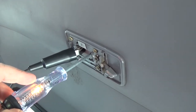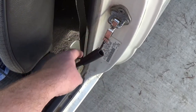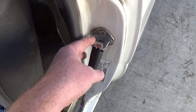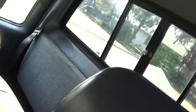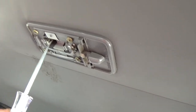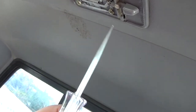So right now I know this circuit is all good and I'd know the light bulb was bad. A little explanation here: the chassis of your car is your ground — your ground cable grounds it out. So your chassis is considered negative. If you hook your test light up to a ground point — in this case I just clipped it on the door striker — you can take the other probe of the test light and check for power. I have it in the off position and I touch one side and nothing's happening.